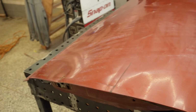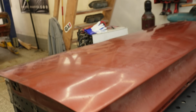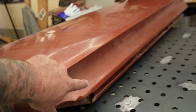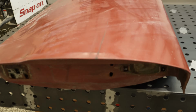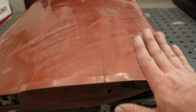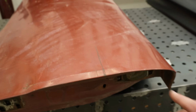But from here, guys, we'll take our grinder and grind all three edges here: the side, the bottom, and the other side. The top is actually held on with just a couple little spot welds around the edge, so we'll split this corner on this side. I think there's one or two little parts holding it here, but the rest of the top actually just hangs over the edge of the door shell. And when I say split, you guys will see it here. You very lightly touch right on the very edge of the door itself, and you'll see the pieces split apart. When you see that, stop, move over, and keep working your way all the way around the rest of the door. So let me go ahead, grab a grinder and a flap wheel, and let's get this door skin off this shelf.